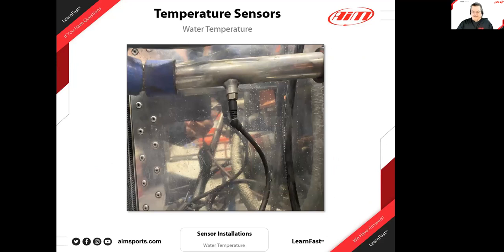The first thing we're going to talk about is temperature sensors. This is one of the sports 2000s that I work on. It's a common place to put it — in the upper radiator hose — because you really do get an idea of what the head temperature is or what the engine is doing. If it starts to get hot, you're going to see it. If the temperature starts to go down, you have a problem — you're either losing water, have steam, or whatever. I call it a health sensor; it's one of the most important ones because it really does save you from spending a lot of money rebuilding your engine.